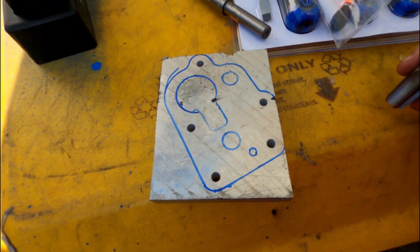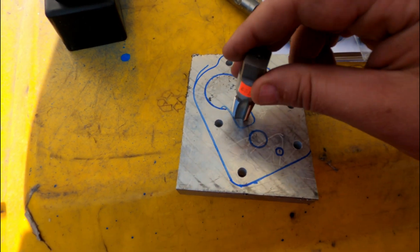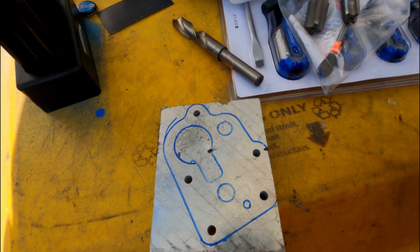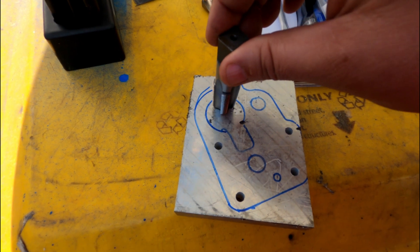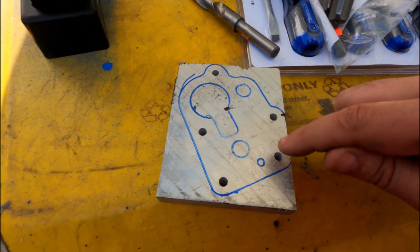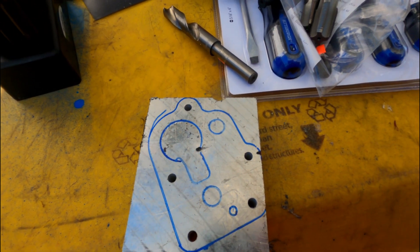We're back outside. With the back side sketched out — I didn't take as much care because I don't care as much. Here's a 3/8 tap that barely fits right there in the inner spot, so I'm going to use this for the turbo feed — 3/8 MPT to a straight push-lock rubber hose. Here's a 1/2 MPT; this is the actual feed but I'm going to slot this and put it over here. This is the return, so this gets drilled all the way through, these get drilled partially and slotted, and this one just gets opened up.